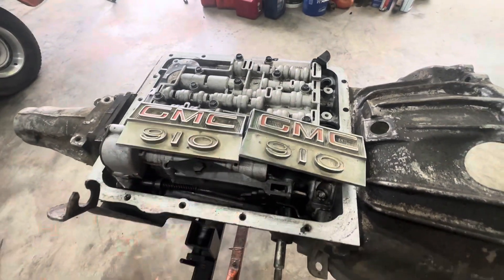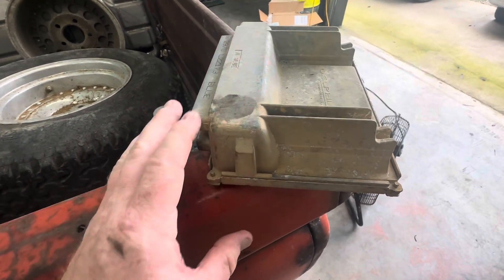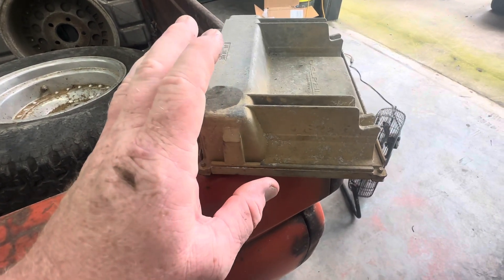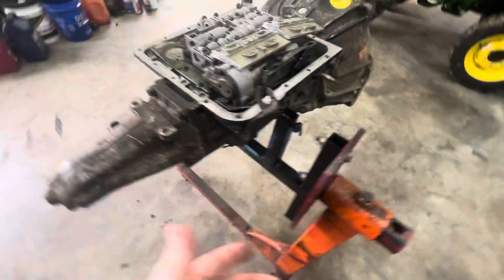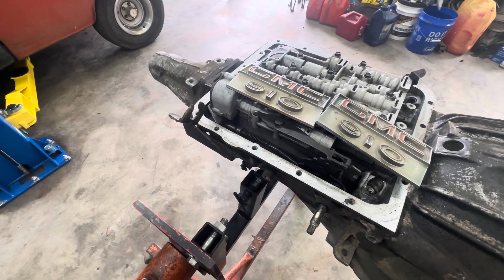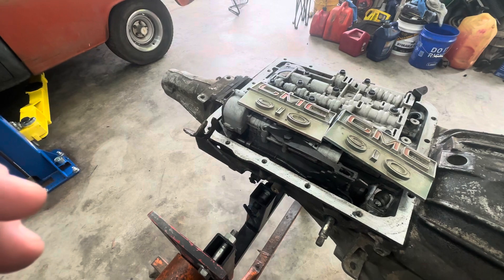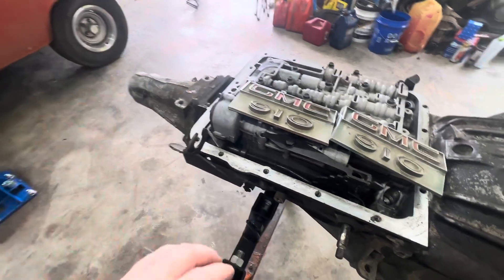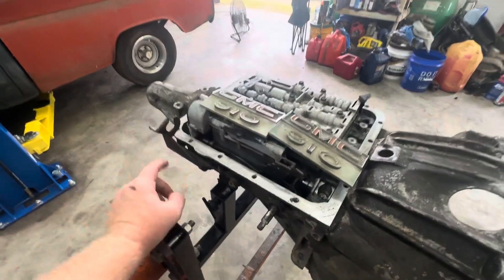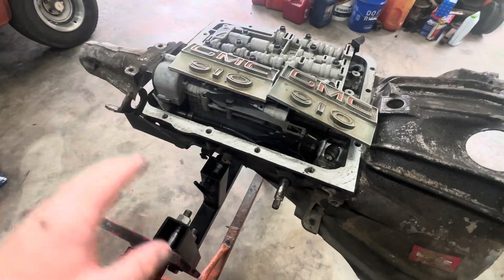I've got a 5.3 in a 2001 Chevrolet truck just down in my junkyard that I've got to get pulled out. Here is the computer out of that truck — I'm going to have a buddy of mine tune it. When I say tuned, he's just going to cut the VATS off, cut the downstream O2s, and maybe reset the fan temperatures to kick on and off at certain times. It's a red and blue computer so I'm not sure all of that is possible with that one — he's the tuner, he'll tell me.